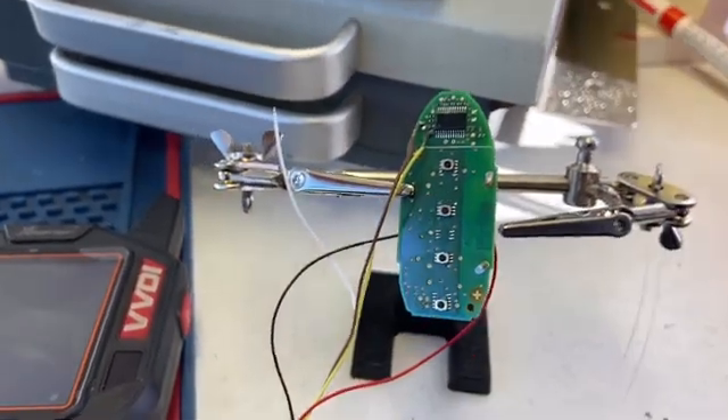It's really easy — just read the PCB number on the board. For aftermarket smart keys the diagram is different, so we need to connect our brown wire to pin 26 and yellow wire to pin 25 directly on the chip. As you can see, this chip has 28 pins — 14 on each side — and we need to attach to pins 26 and 25.